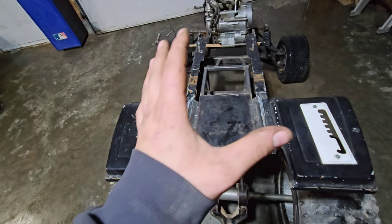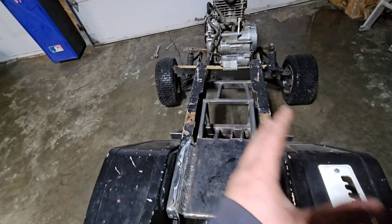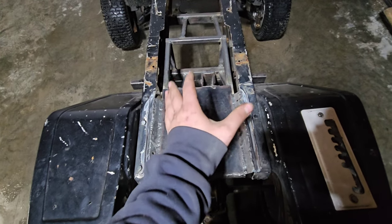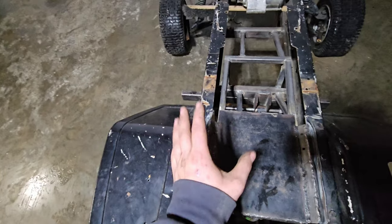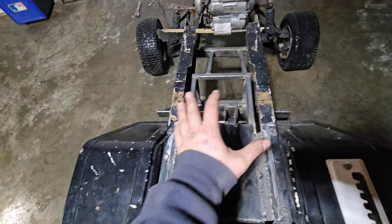All I can see right here is a tubing that I'll need to cut because it'll be in the way. So we did a lot of things today - the whole frame is completely welded and I reinforced a lot of things. The side panels were flopping around; I cut the old chassis plate and welded a new metal plate so now the side panels are welded onto it, and that plate is welded onto the frame extension - super duper solid. What we need to do in the next video: start the engine, reposition the engine, buy a longer chain, finish the frame, and buy two sprockets because the engine sprocket and swing arm sprocket don't have the same tooth size. Hope you all enjoyed this video - catch y'all on the next one, peace.